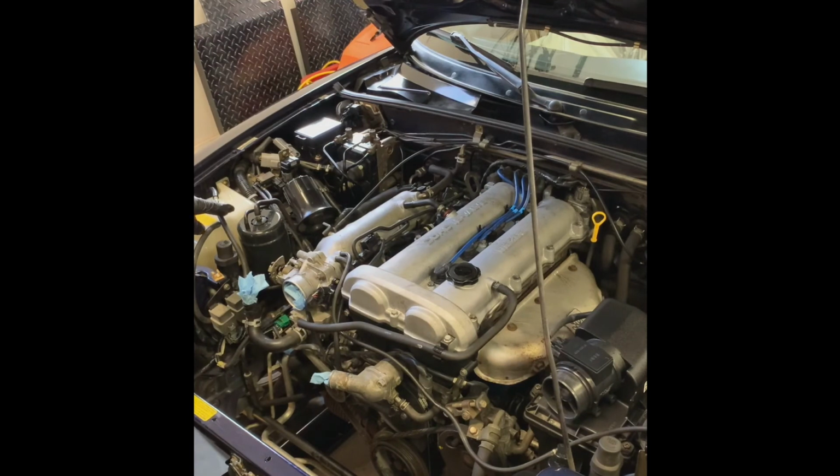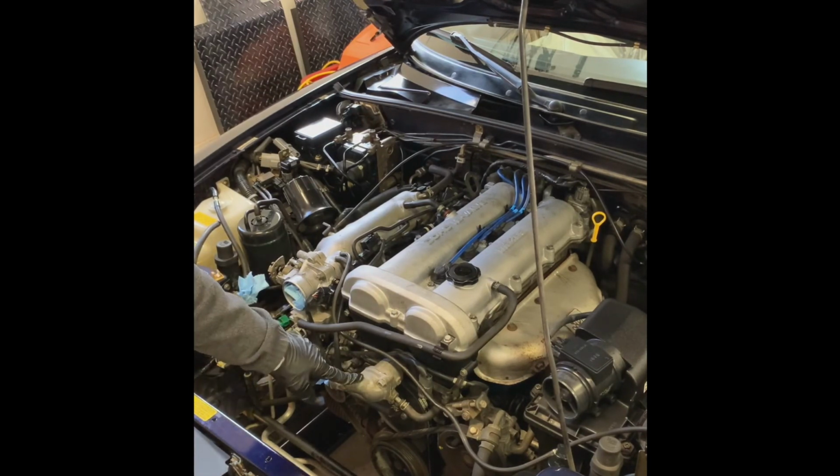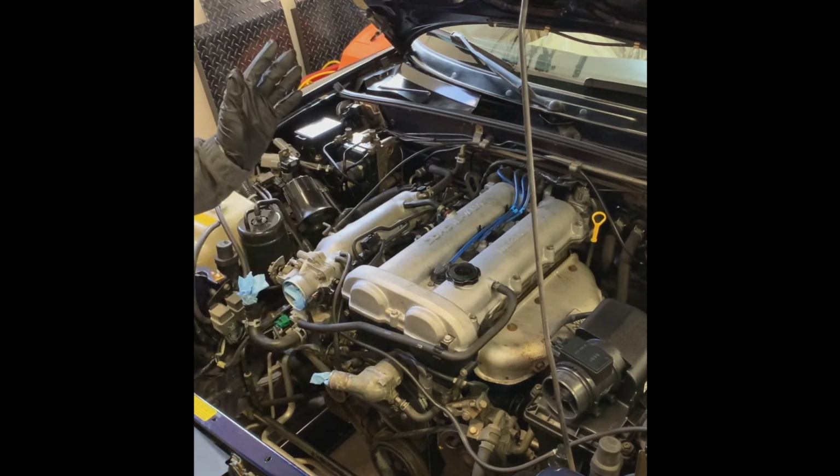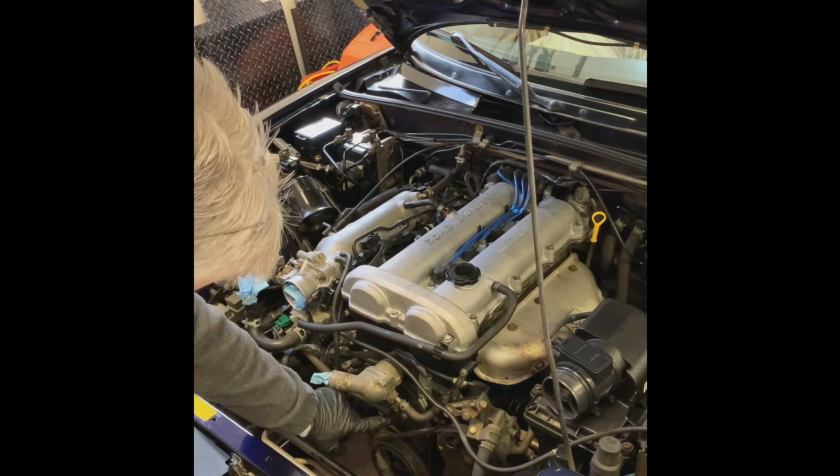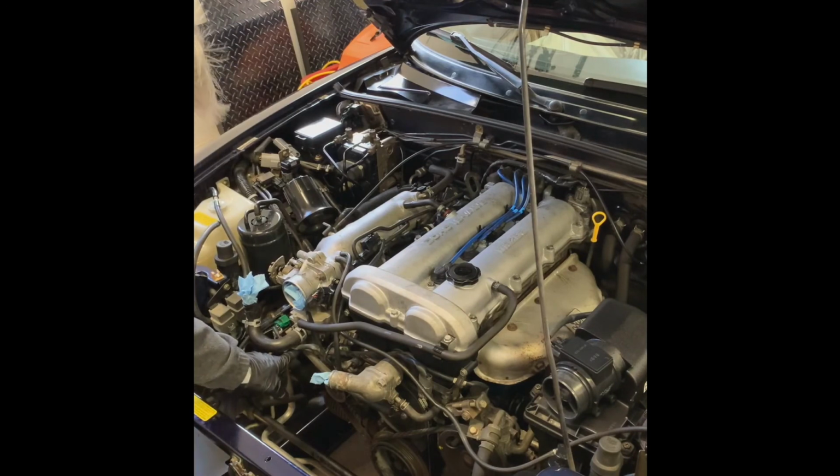this line that connects us to the radiator and the overflow. We have obviously the tube that came in here that connected us to the thermostat housing. We're going to go ahead and replace our thermostat because, well, why not? The other thing we have in here, we've got a couple of other hoses that are part of the cooling system. So there's a bypass line that runs along here that we're going to try to get.